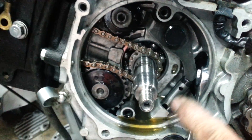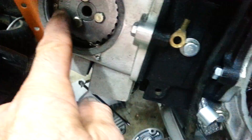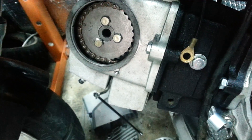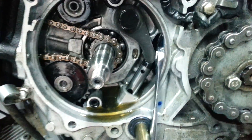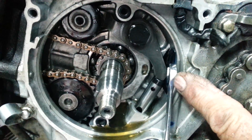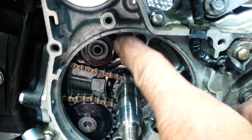Under there is your timing chain and your hydraulic tensioner. You have to take the pressure off if you are trying to get your cam chain back on, because the tensioner has put tension on it that you didn't want. So I put a wrench in between the wall of that to push the plunger down, to raise the lever so my wheel is not on the chain.